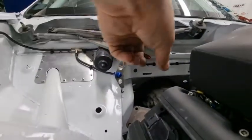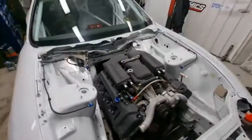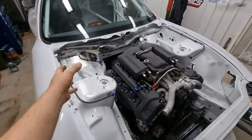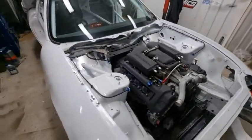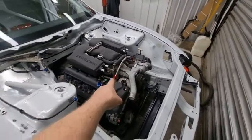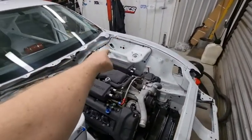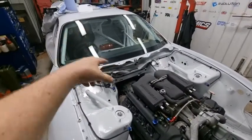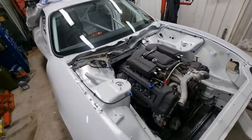I've also mounted two AN6 bulkhead fittings and another little aluminium plate mounted behind the bulkhead — that's for our fuel lines. I'm going to run AN6 Teflon all the way inside the cage. It makes perfect sense to put it inside the cage for safety, and AN6 Teflon is to the highest standard required. Everything in here is done. I'm going to make one plate to go over that hole, which is where I'll bring the loom in — a plate with a 40mm hole for a grommet, running down the chassis leg. Once I've done that I can put my scuttle on and my wipers on.